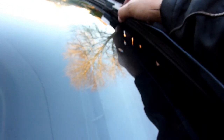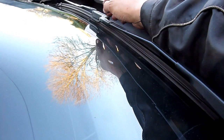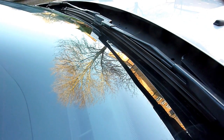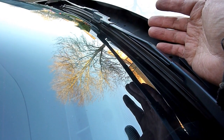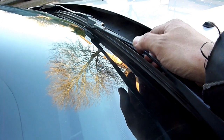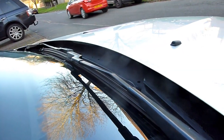One week prior, check your windscreen wiper quality — how much have they degraded? I use silicone wiper blades, either fitted by me or they came with the car. Silicone ones last a lot longer. Check the functionality: is the water squirting out to clean the screen? Is it sweeping, is it cleaning, is it leaving streaks? The rubber-based ones have far less resistance to ozone and pollution, but silicone ones are much better. Check the rear wiper as well.